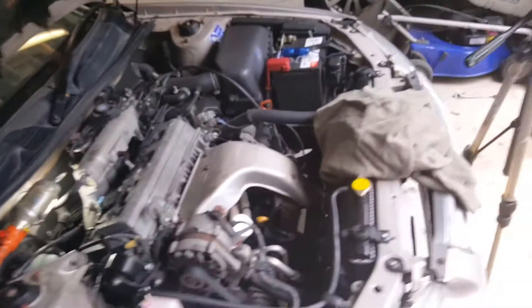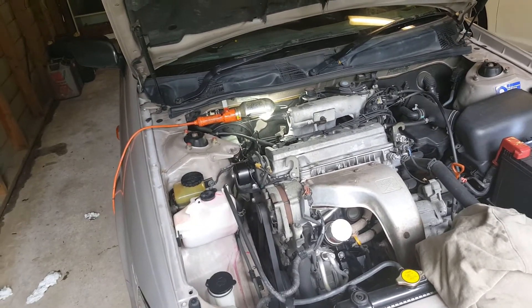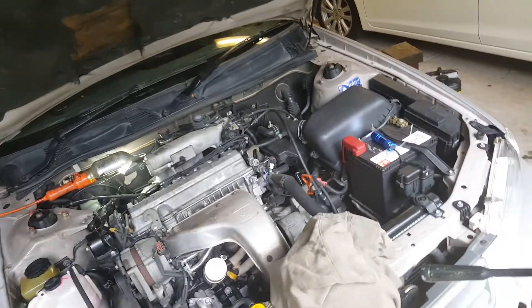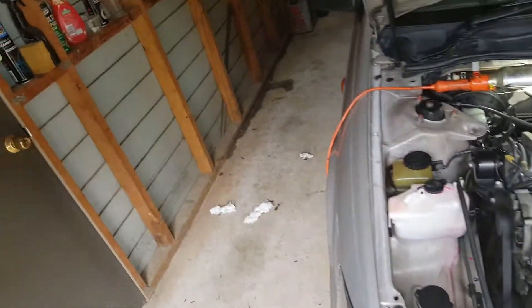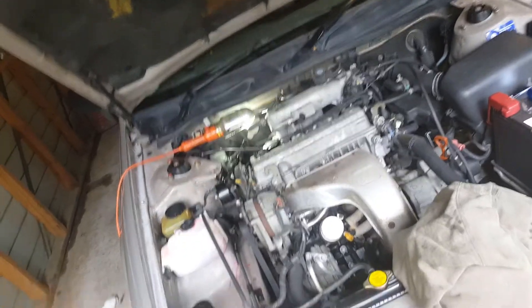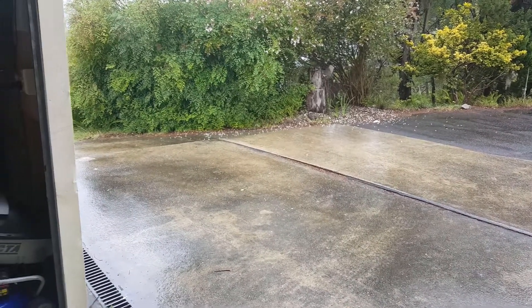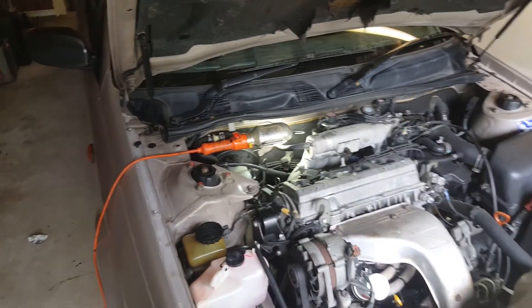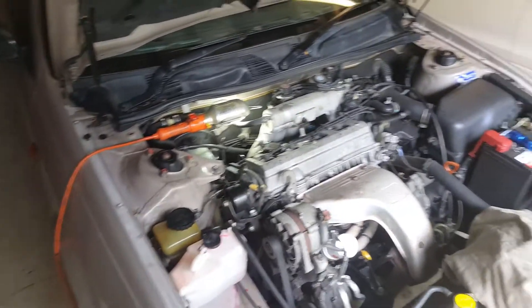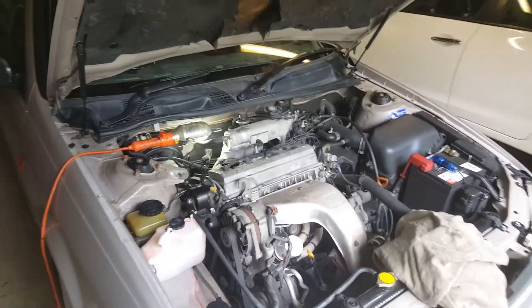It was fairly painless. Surprising how thick and dirty the original engine oil was - it seemed like possibly 60-weight oil. I shouldn't really do this, but I've added 40-weight and 60-weight together, which gives 50-weight, and it is the same manufacturer. However, if you're in the US or especially Canada where it gets very cold, the viscosity is very important and you'd want to use synthetic oil. Just use whatever oil is recommended by the manufacturer.